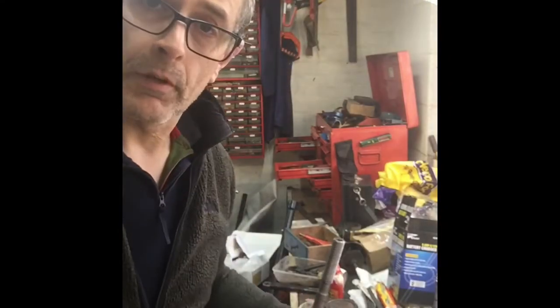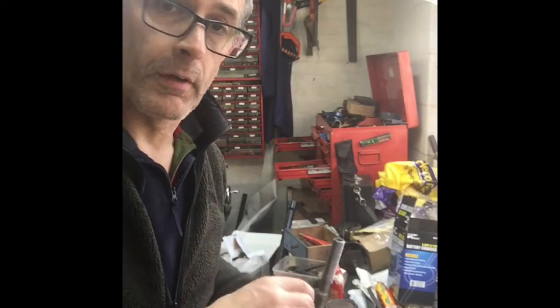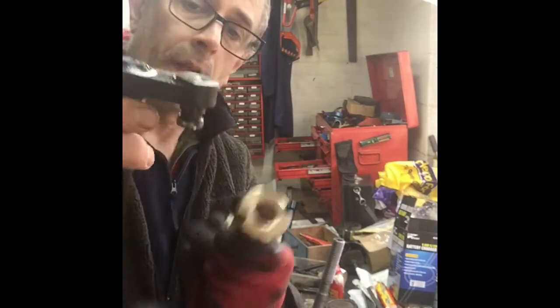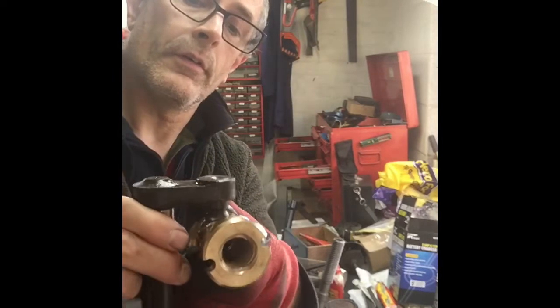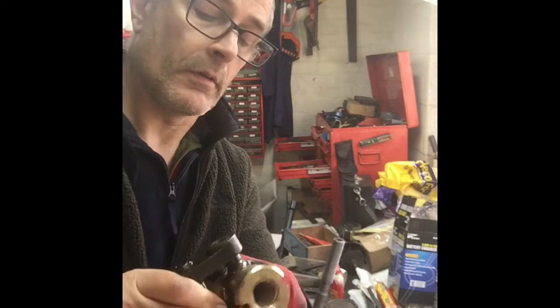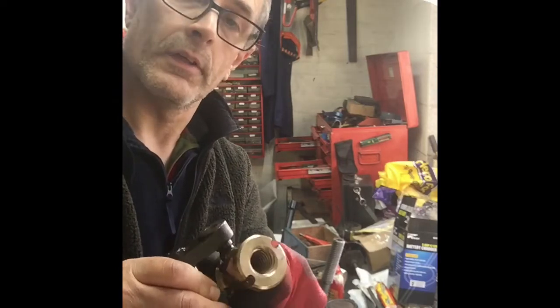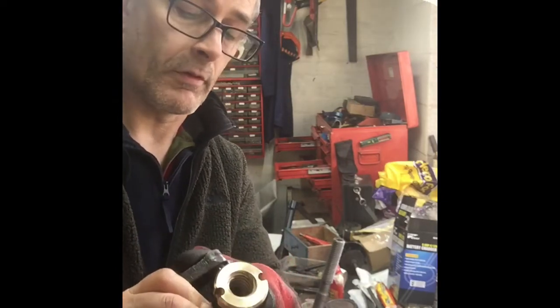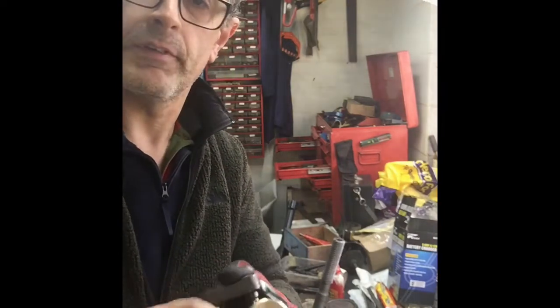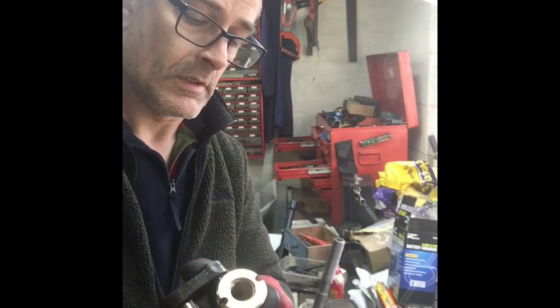I've just noticed as well on the box, that's the operating arm out of the box that drops out with the steering arm on the bottom, and that part there is what sits in this nut, but it's a bit on the tight side. Well, it won't go in, so I've got to ease that somehow carefully, taking the absolute minimum off, so it's a nice fit, but it just won't quite go in. It's probably tenths of a thou there, but it's not quite there.